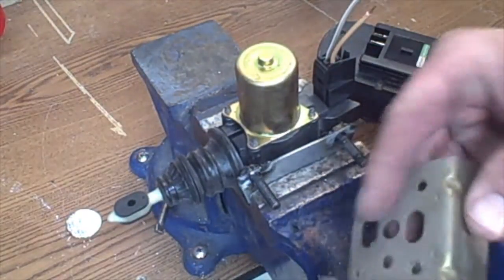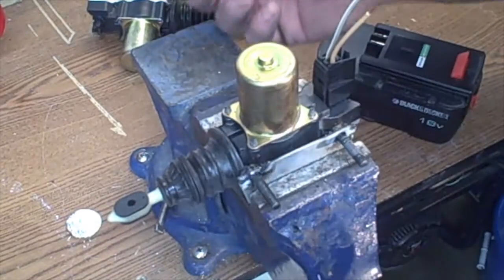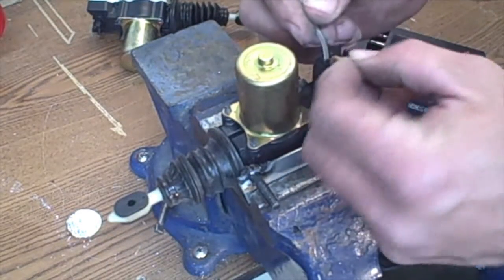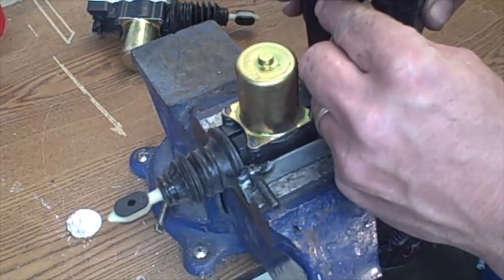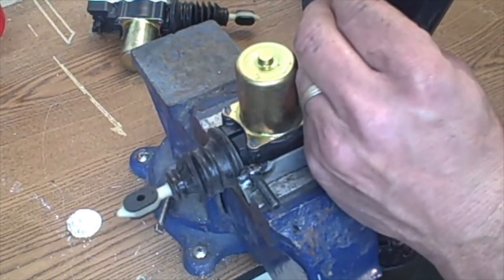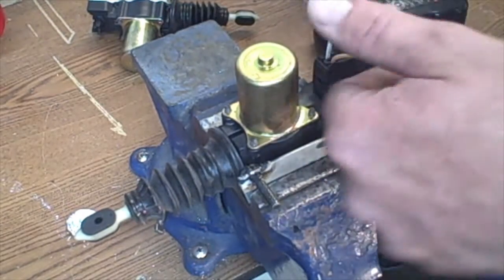I switched it over — this thing just comes off the back, simple like this. So I switched it over and welded that piece on there. Now if you want to replace this with an aftermarket actuator, it's really easy to do. You just use this mounting hardware, bolt the new piece to this — you'll have to maybe drill some holes or whatever. But it's the same 12-volt system. I've got a 12-volt battery right here and I'll show you what it will do. You just wire it up — that's open, reverse the polarity and that's closed. So you can wire up an aftermarket one the exact same way; the hardware might be a little bit different, but it's just two wires, simple 12-volt system operation.